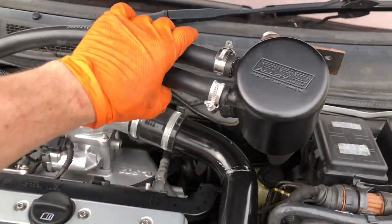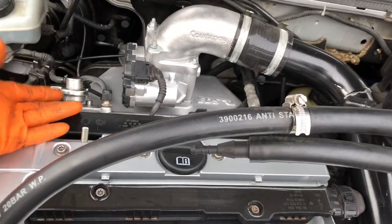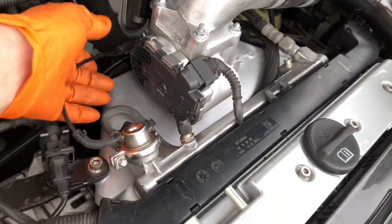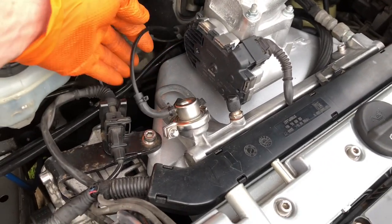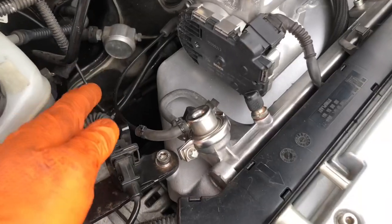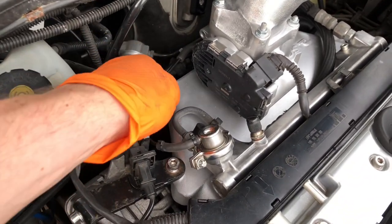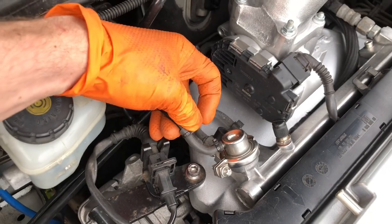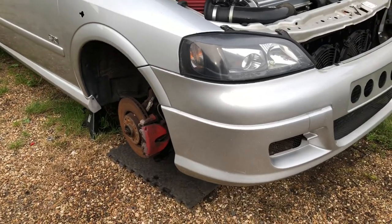Last thing to do is fit this breather system that I made up a long time ago for the car. These are the breather systems I use on the high power engines - relieves any crankcase pressure out of the engine to the main breather. This one normally goes to the throttle body but I reuse that just for fuel pressure. The reason being is when you're running higher power cars, if a vacuum line pops off on boost that's not dedicated for fuel pressure, you're going to have no accurate fuel pressure. That's why I always run separate lines going to the boost gauges and recirc valve because those aren't as important if they pop off. The one going to the fuel pressure regulator is the most important. Use cable ties or clips to keep them on nice and tight because you never want that popping off.